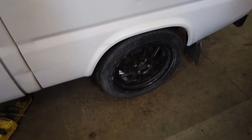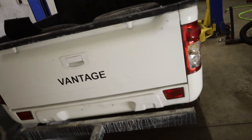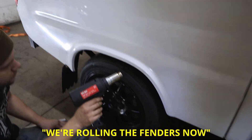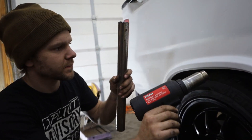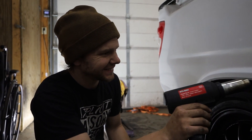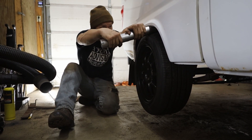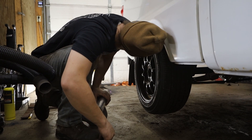It's definitely resting on the tires — the tires are literally holding the truck up. So we're rolling the fenders now. We're going to do it the cheapest way possible and not buy a fender roller. We got a pipe that'll do the trick — and then a pipe bigger than this, and then a pipe bigger than that. We're going to have a full blown wide body pandem kit by the time we're done. She's a little paint flakey but way less sharp too.